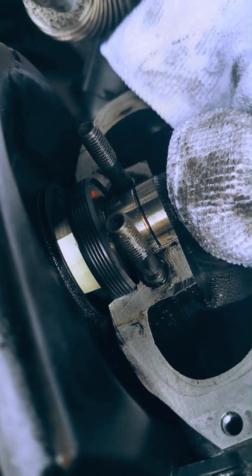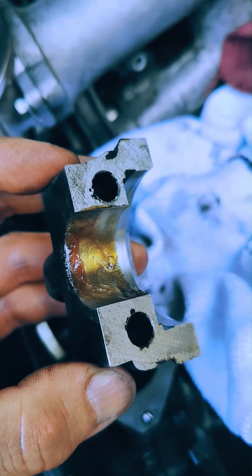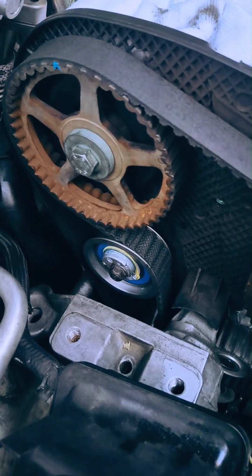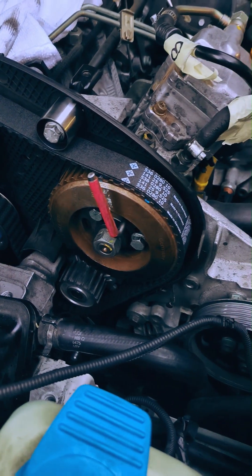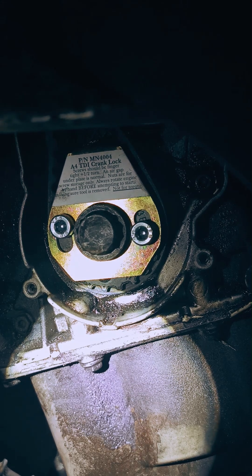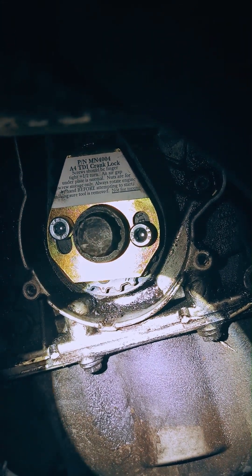A simple piece of tape as a shoehorn covers any sharp edges, and some engine assembly grease on the bearing cap before reinstalling. Here we finally have the new belt installed and routed around each pulley and roller sprocket and tensioner. While the cam and injection pump are locked with respect to crank and piston TDC, the sprockets are allowed to rotate into position to accommodate the new belt while the crank is locked in place to maintain TDC.